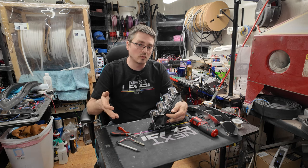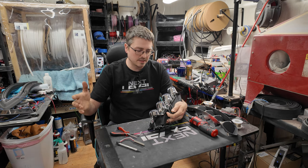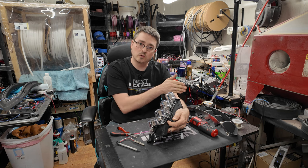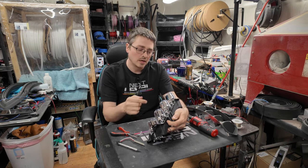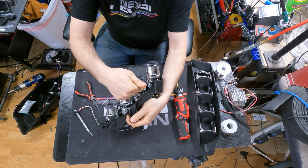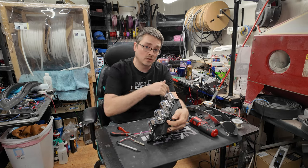But in general, when wiring things up, if you can, it's a good idea to have things flow uniformly. So in the case of this light, the projector closest to the grill, and so in general flow motion, sequential turns or things like that, it's gonna flow from here outward. So I'm probably gonna want to put my data in here, data out to the data in here, data out to the data in here, data out to the data in there. And I am gonna use wiring to connect all that together.